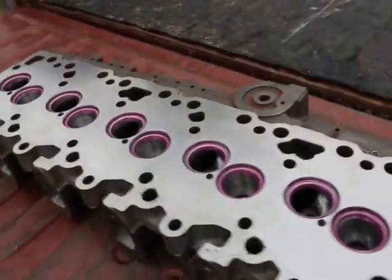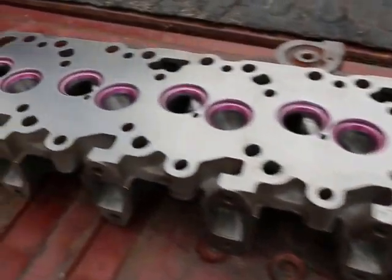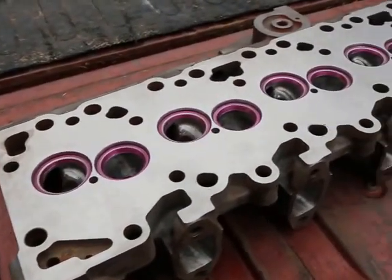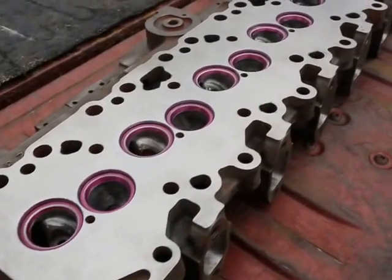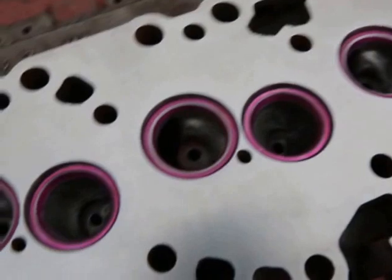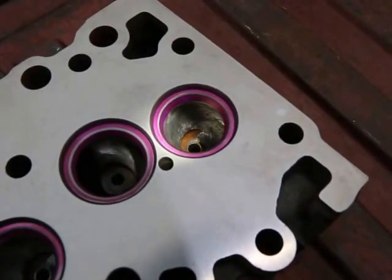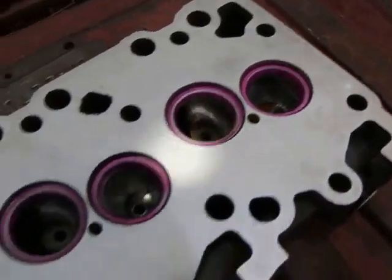Overview: we're learning how to do this a lot quicker, but this is about 25 hours of work to get them all port-matched, gasket-roughed-out, and then the final cleaning and polishing with the sanding drums. The coarse sanding drums worked pretty well for leaving a finish. When you compare this next to an OEM head, the difference in smoothness of the runner is drastic. It opens up a lot of material in the exhaust port especially, which would really increase airflow — and if you're using a big charger, it might substantially increase efficiency.